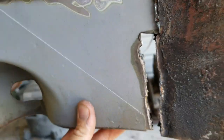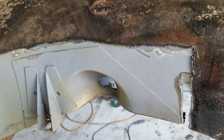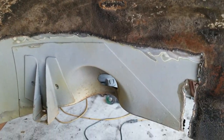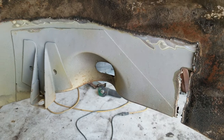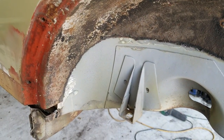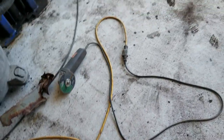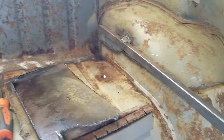When this gets done I can sand and grind this down, add filler, and you'll never see it - it's in your fender well. It all depends on what you feel like doing; you don't have to do it, that's up to you. I'm just showing you guys how this can be done to save yourself some time. You have to really look at the task at hand, think about what's gonna change when you put the piece in, do the math in your head, and make sure you're not so far off that it's gonna matter. That's how it fits.